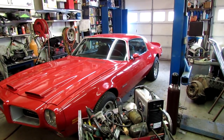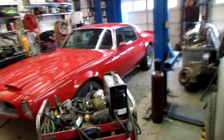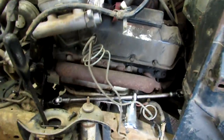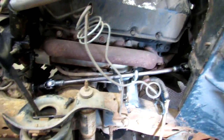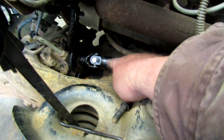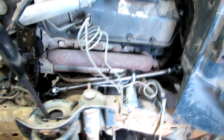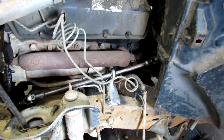It was 38 degrees in here but I got it up to 55. I'm going to go ahead and pull the steering column back out and cut right there and put these U-joints in phase, just because that's going to bug me. I think that's going to be okay — let's go ahead and do it now.